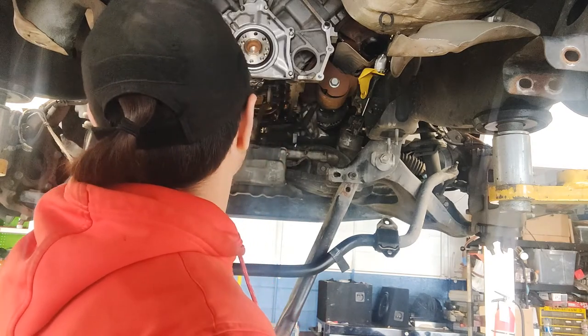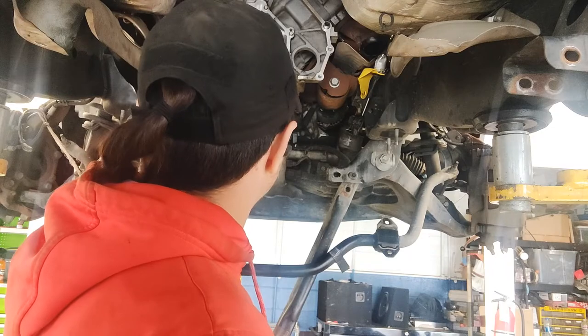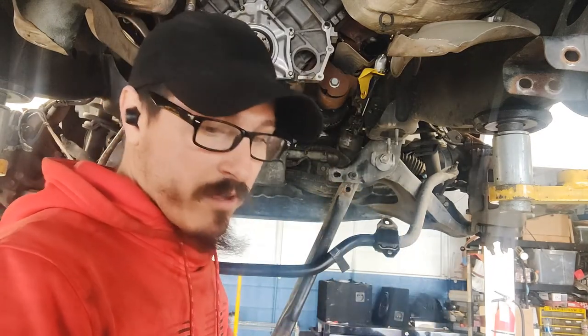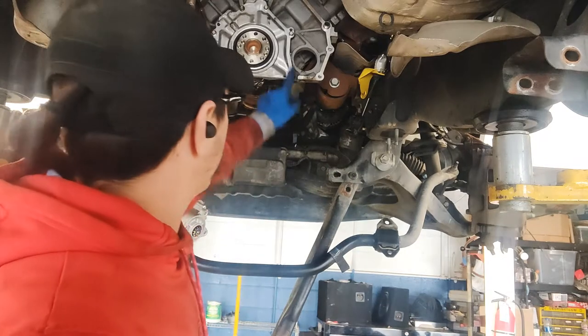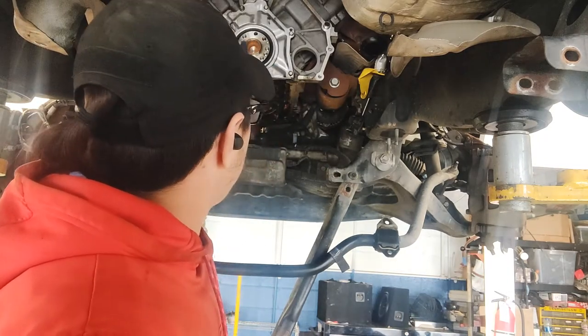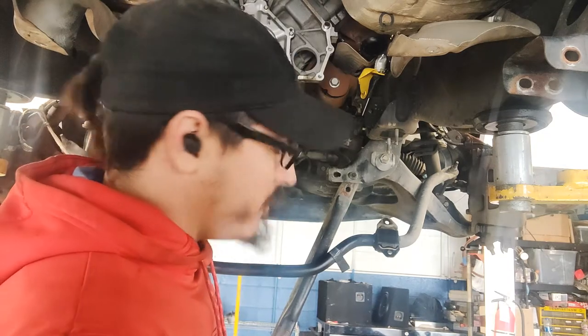So yeah, so let me just go ahead and place the oil pan back in. Let me get that torque down. So when you're working on gaskets, yes, you do want to torque from the specs. Like I said, this one was 89 inch pounds of torque. There was a specific sequence, and then you do an additional, in the same sequence, 45 degrees.